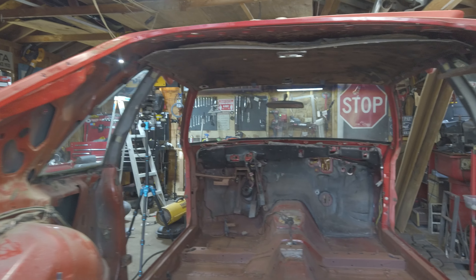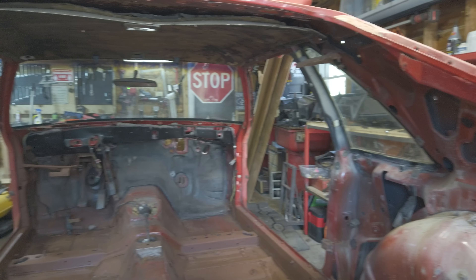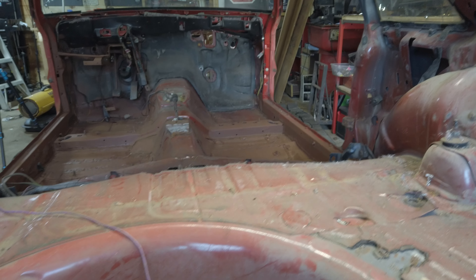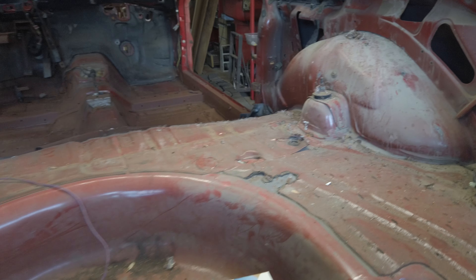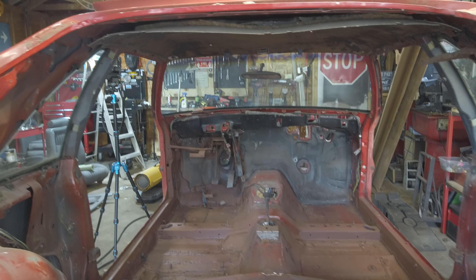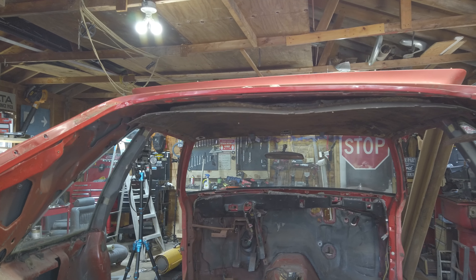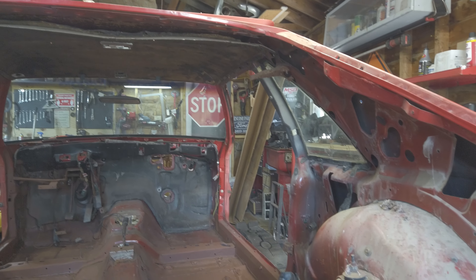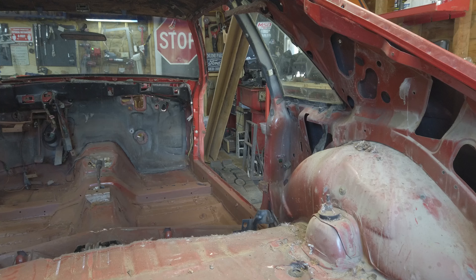It had some dents in it which are gonna be tricky to pull. I want to pull the glass out, I'm gonna mask the door opening, and then probably mask this trunk area because I'm not really gonna paint the inside of this car since it looks really good. I'll paint the floor but tape all that off and do the floor separate. I gotta get the glass out because I want to tint the windows, and these cars have a problem with the rear glass leaking, so I'm gonna redo the butyl on the windows anyway.